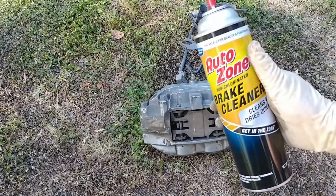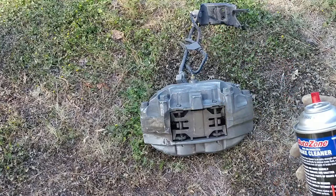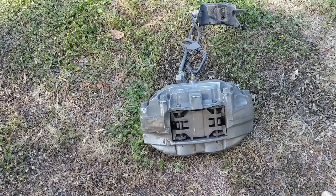The first thing you're going to need is any brake cleaner. Now people say they don't want to spray brake cleaner onto the brake because it's going to ruin the paint. However, you've got to remember that when they paint these things, they use basically some good high-temperature paint that's very strong in terms of any chemicals you spray on it, or even the heat.